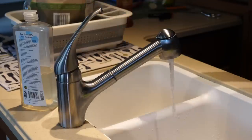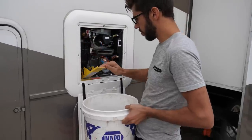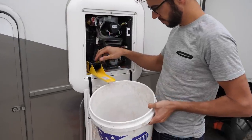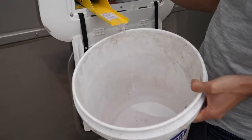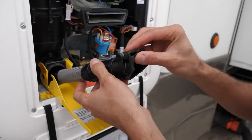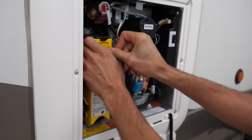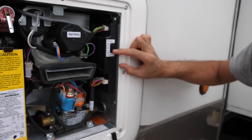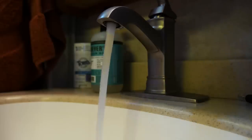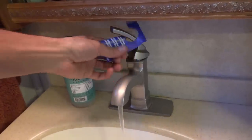Now the water heater needs to be drained one more time, so turn off the water supply or the water pump. Open a hot water faucet to relieve pressure in the system. Outside the RV at the water heater, switch the appliance to the off position, open the drain lever and drain the system. Remove the water inlet filter and inspect it for any pieces of decalcification tablets that did not dissolve — clean it out if necessary. Once drained, reinstall the water inlet filter, turn on the water supply or water pump, and fill the system once again. Before you use the system be sure to check the water color — if it's slightly red, rinse the system again; if it's clear, the decalcification is finished. You can now remove the warning signs from your faucets.